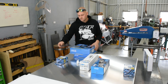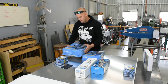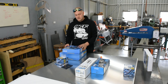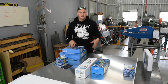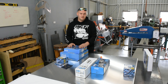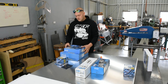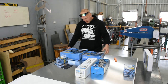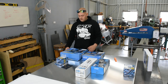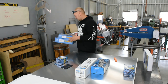In terms of cooling the motor, we'll be running a couple of thermos on the radiator. We're going to be recessing the radiator under the radiator support just to allow room for the blower drive, the magneto, the fuel pump and things like that. We're running a 12 inch and a 14 inch high power fan — they flow an incredible amount of air for the size of the fan that they are.